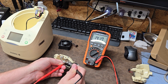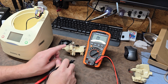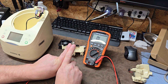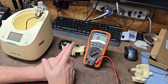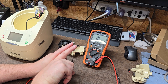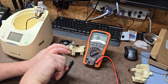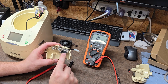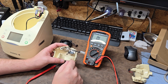This little thermal disconnect right here is at 150 ohms. That is a bimetallic strip, which means there are two different metals put together. What happens when that metallic strip heats up is - with two different types of metals - they expand and contract at different rates. That creates a curve: one metal is expanding faster than the other, and that curve basically creates a spring or a disconnect which pushes against two contact points and opens them up. That is a thermal disconnect.